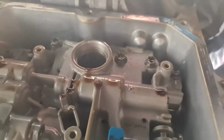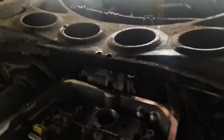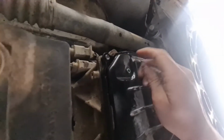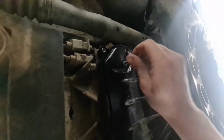So when you're putting in the filter, there's this bit here, this hole has to line up with that one right there. So you're just gonna shove it in and then put the 4 screws either side straight up, and then you're done. So once you've put everything back together and torqued all the bolts to 7 pounds, you just got to put that green thing back in, the little leveler, this one right here. Put that in just until it seats to the top.